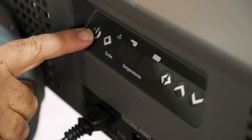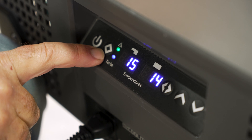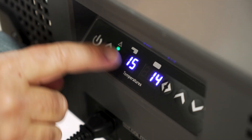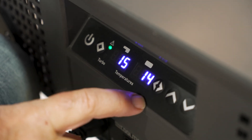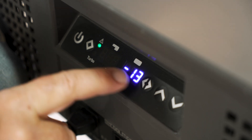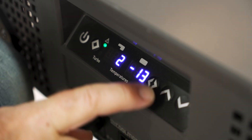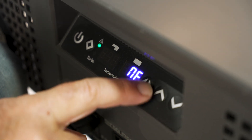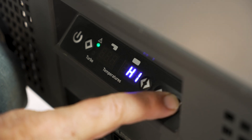So let's have a look at how these controls work. You've got your on/off switch here — I'll press that on. You'll see it's turned on and it's showing the temperature for each compartment. You have a turbo button here — the turbo increases the speed of the compressor so you can achieve your temperatures much faster. Now, you've got two temperature zones. If you want to change the temperature, you push this button once and the side that's flashing you can alter by going up or down. Push it a second time and the other side flashes so you can change that temperature too. Push this button again and you go to Celsius or Fahrenheit. A third time, you go to medium — this is battery protection — so that's your medium level, low protection, and high protection.